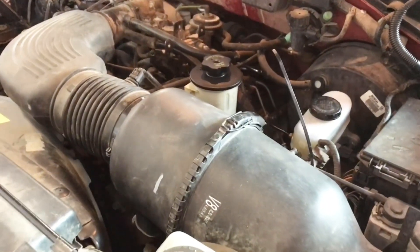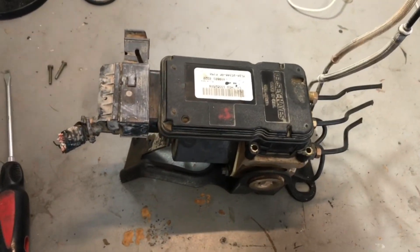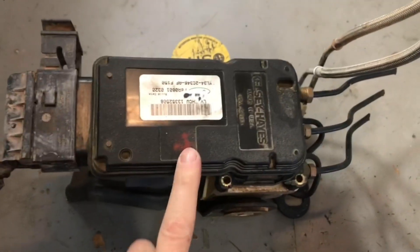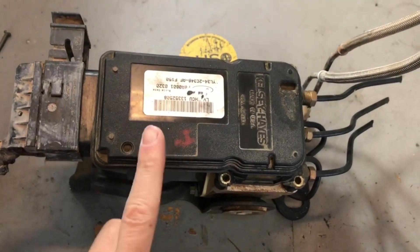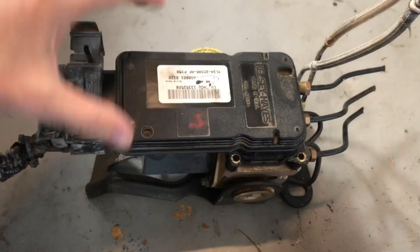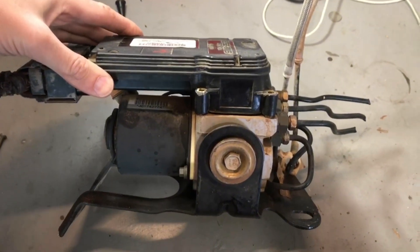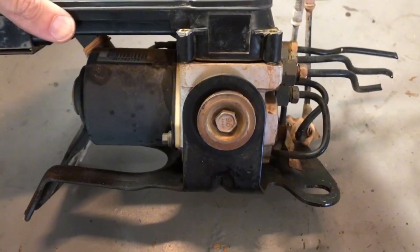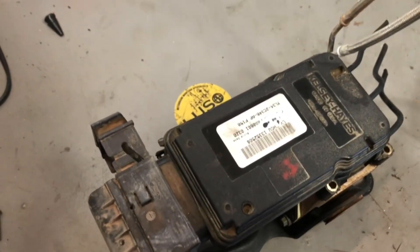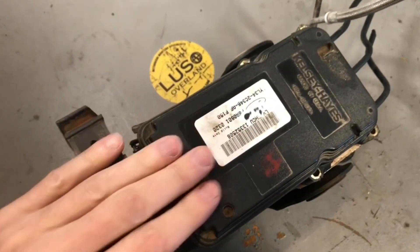Let's start with what I did, which is a junkyard donor. Here's a completely separate unit out on the bench. This was actually what was in the truck — the previous owner had already tried fixing the problem with a junkyard unit. You can see it's got the paint marker on there for when they bought it at a junkyard. There are two separate parts here: you've got the module on top, which is the electronic controller for the ABS system, and then you have the actual pump or motor on the bottom. If your pump is running, pretty much the only thing you need to do is stop it from running so that it only runs when it needs to — and that's the module's job.